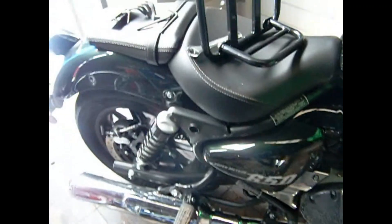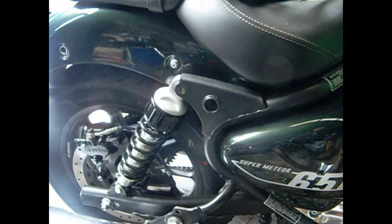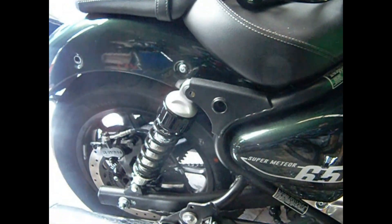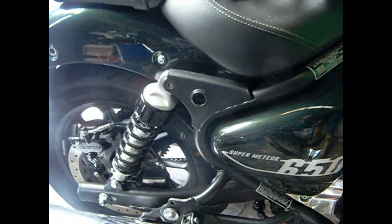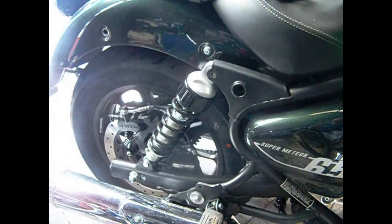I have now removed more of the bolts from the back of the bike, and I removed the bolt holding the rear shock on. You're going to want to make sure — if you've got preload on there — I would recommend you pull it back down to the factory original setting so there's no preload on your spring. You're going to need a pair of 14 millimeter end wrenches in order to do this.